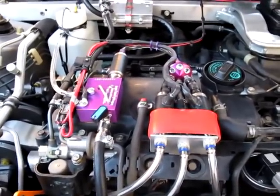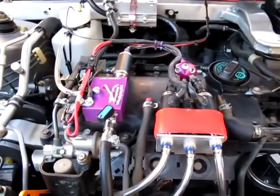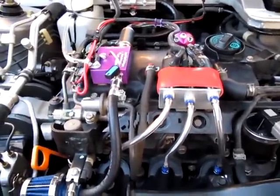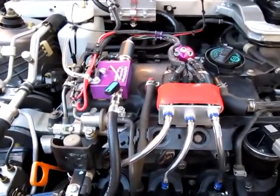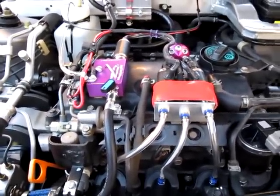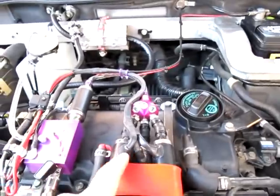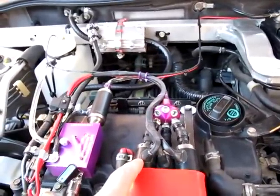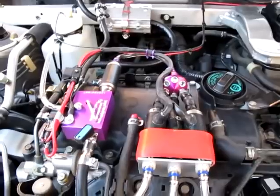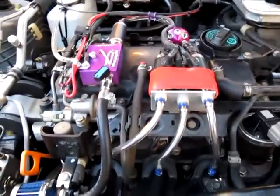This is not just a water injection system. It's primarily hydrogen injection, and it also injects water. Even that water being injected is usable energy with the way that it works. It's very detailed and very technical, and I love understanding the way things work. I'll make another video that goes into more detail about this system. This is just a basic introduction to the AquaTune HB, to show that these generators do produce hydrogen: 2.5 liters of hydrogen per minute, each generator at only 1.5 amps. That's very efficient, meaning very low power consumption for the fuel that it produces, which is what interests me in the system.